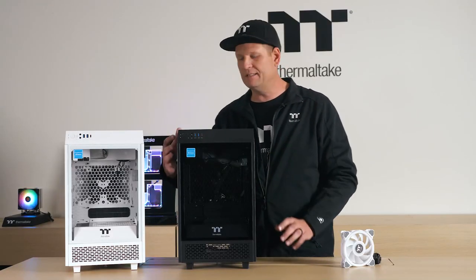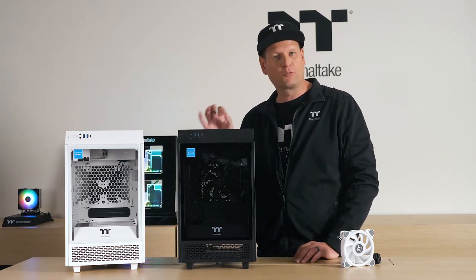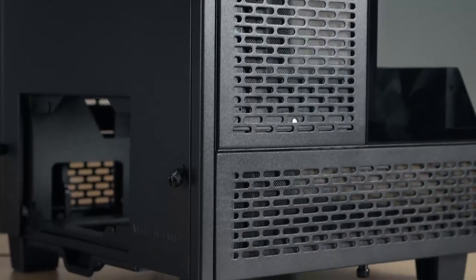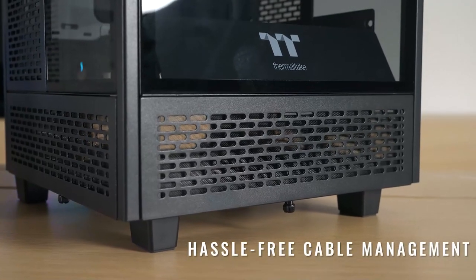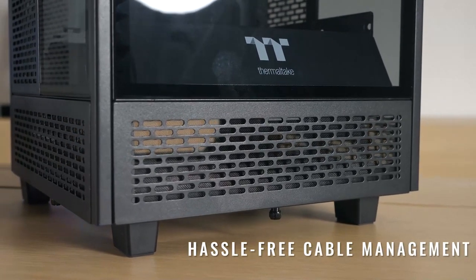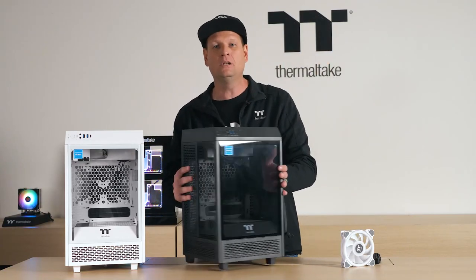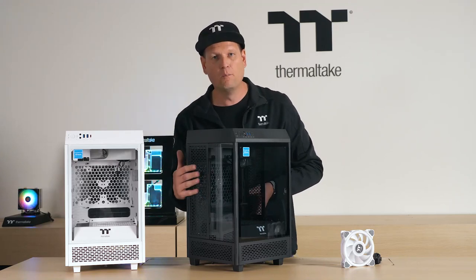And the thing I really like is, even for an RTX 3090 that runs around 300 or so millimeters in length, the card itself will go all the way down, and then it will even pass through underneath this power cover that we have. So it cleans up the cable management just as well, and all you see is that big beefy card. And then you have the nice ventilation here on the side, more or less dedicated for that graphics card for more airflow.